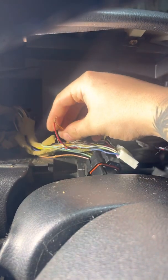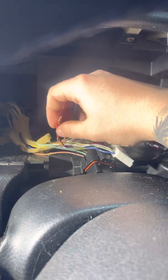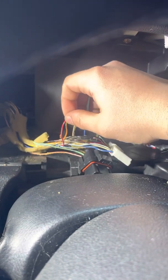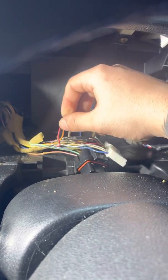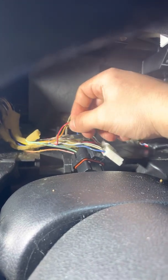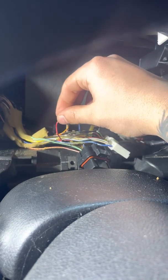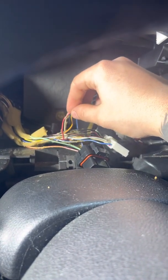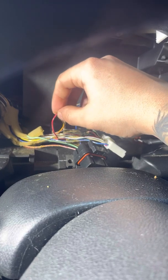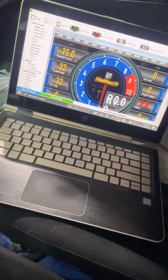You may be wondering why I have these two wires looped together. The yellow with red is the one that powers the stock cluster, and the full red wire is the one that goes to the alternator. Without it, the battery will not charge. This is a temporary setup — I will have to add a 3-ohm resistor in line because it already blew a fuse this way. That resistor will take the load of the light bulb that is normally between these two wires.